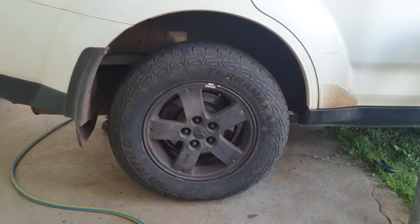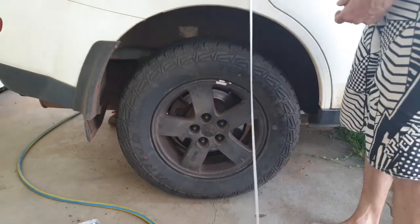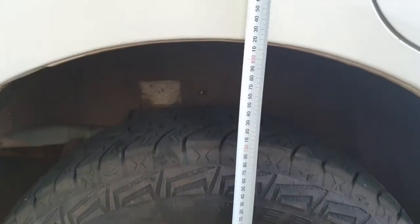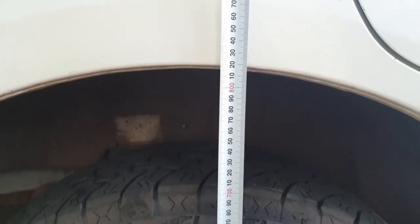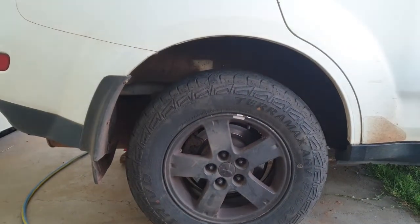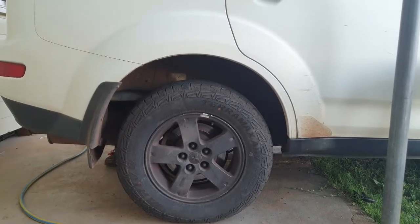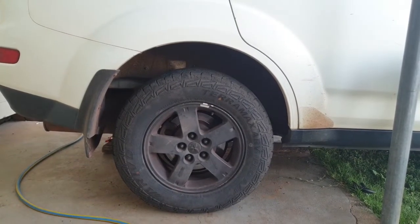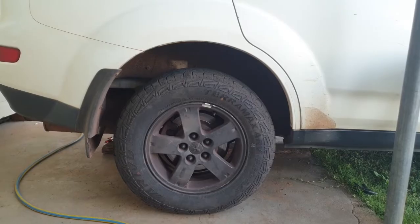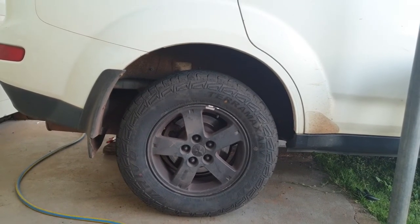Everything's back together and the car is sitting on its own suspension now. I'm busting out the tape measure - I didn't get a measurement from before but I measured this side before doing it and we're at about 823mm, so I'm pretty sure we've got our expected 30mm gain from those springs. Combined with the tires, we've got a total height increase of about 70mm - I'd call that a win. If you enjoyed this video please hit the like and subscribe buttons, and feel free to leave a comment. Thanks for joining me - stay tuned, JFix.